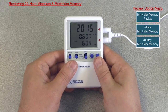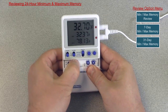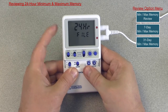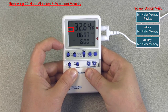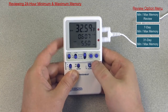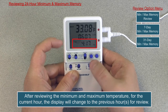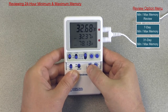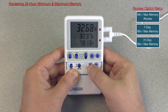To view the 24-hour min/max memory, slide the display switch to the min/max position. Slide the history switch to the on position. Slide the period switch to HR. Press the event date/time button three times to begin viewing the hourly data — the LCD will display the current history viewing mode. The next press of the event date/time button will display the minimum temperature achieved during the current hour. Press the event date/time button again to view the maximum temperature for the current hour. Each subsequent press will display an hourly minimum or maximum reading for previous hour periods in descending chronological order. Once all saved readings have been viewed, the display will return to the default min/max screen. Holding the event date/time button for two seconds, or no button press for 15 seconds, will also return the display to the default min/max screen.